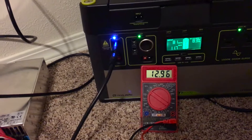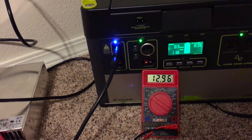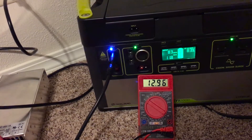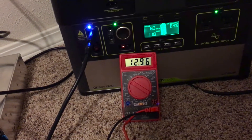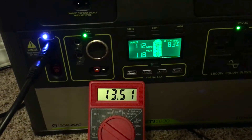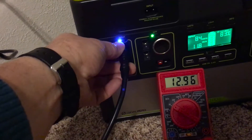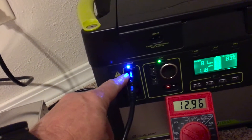But the other problem is you can't control the amperage. That means you could be accepting too many amps for the car's cigarette port — two things could happen: you could blow a fuse, or you could catch something on fire, whether it's the wires or the adapter. You can see it's sitting at 83 watts. Now I'll bump the voltage back down to 12.4 and then put it back up to 14 — watch what happens to the wattage. At 14 volts it's already over the limit — 150, 160, now 197 watts.